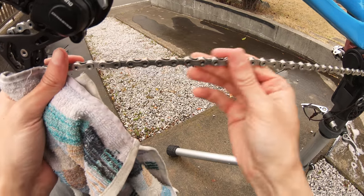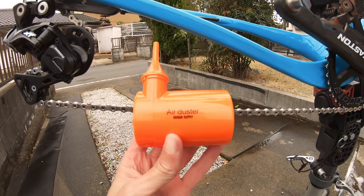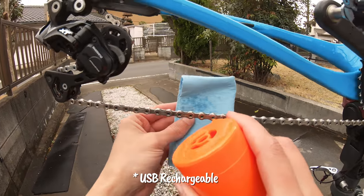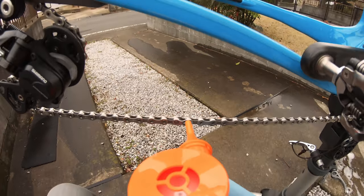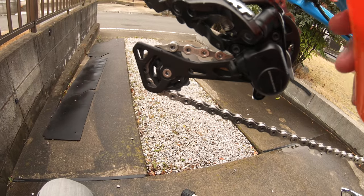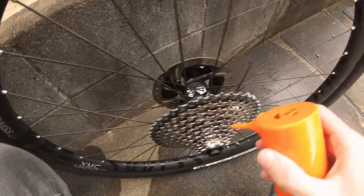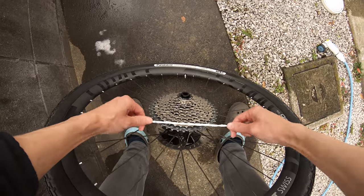I run the chain through another towel — it shouldn't leave much of a mark now. I also use the towel to pinch the pulley wheels to dry those off. Dragging my hand along the chain leaves no mark at all, so I'm happy. Now here's the little air duster — the reason I got it is to remove water that gets stuck inside the chain pins. This USB rechargeable one is just powerful enough to blow the water out of the pins, as you can see on the paper towel. You can also use it to blow water off the cassette, but I prefer a towel for that.